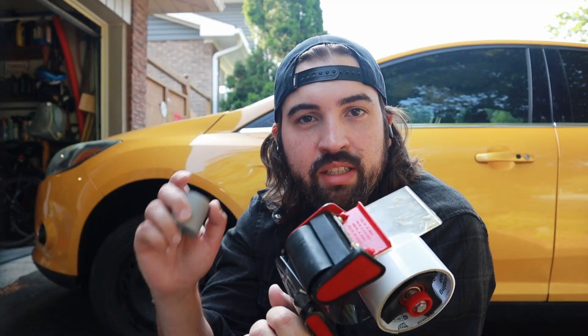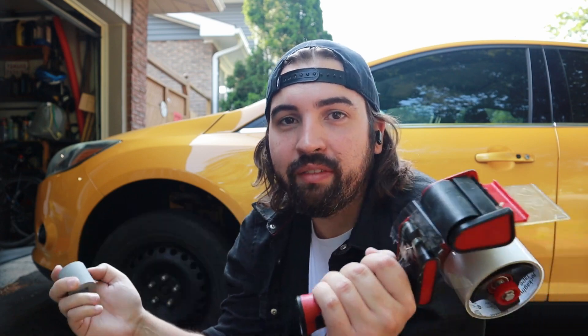I'm going to torque these lug nuts down using a torque wrench. I'm going to start at 40 and go up in increments of 20 until we get to 120. So far nothing's been able to go past 120, but I think this one might — so if it works, we'll keep going higher. It takes slightly less torque to remove a lug nut than it does to tighten it, so keep that in mind. I'm also going to wrap it in tape because with the nylon one, when it broke it just shattered everywhere, and hopefully the tape will catch any fragments if this one does too.